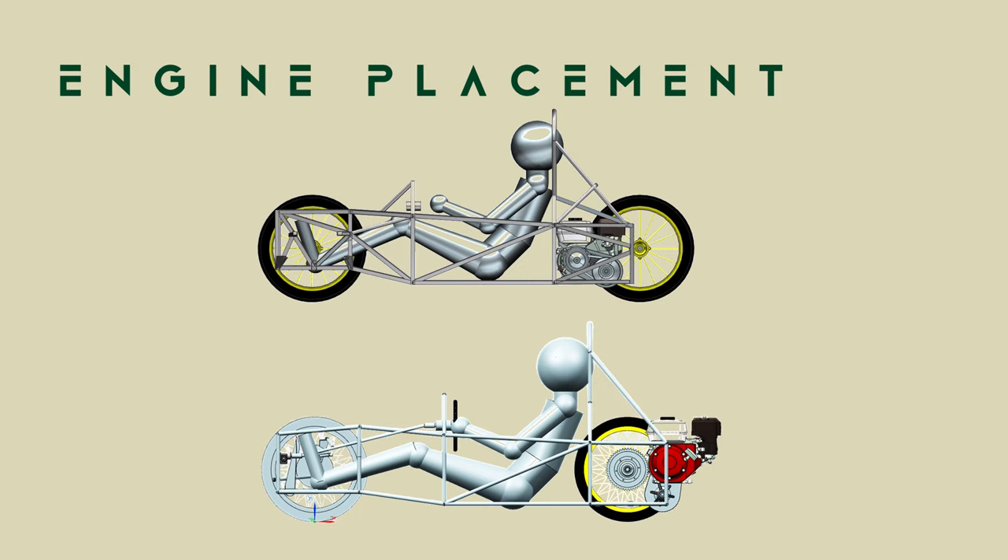Next, we look at the suspension layout. Cycle karts normally use rigid axles — the front has a beam axle and leaf springs, and the rear a rigid drive axle like a go-kart. At the rear, for simplicity, we will stick with the norm: a continuous axle with two inboard pillow block bearings and lateral restraint via the lock screws on the inner bearing race. For the front however, I want to keep the look of the Lotus and have an independent front end with a rocker and spring damper setup. The double wishbone setup aids in keeping steering effort low, spring rates can be quickly adjusted, and they have efficient damping. The leaf springs that suit these karts can also be hard to come by in Australia and are heavy.